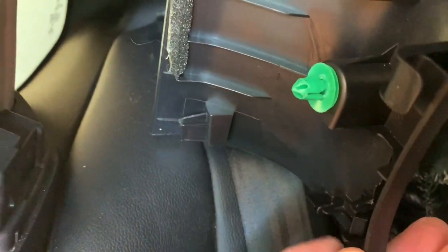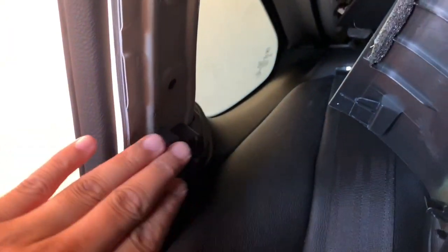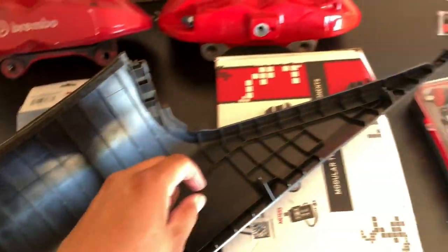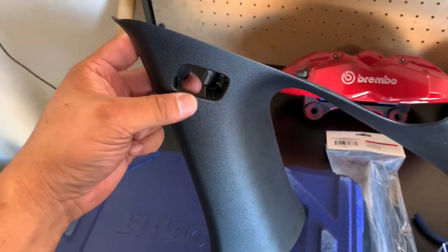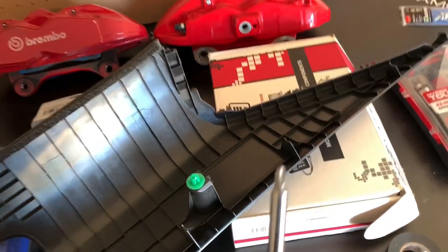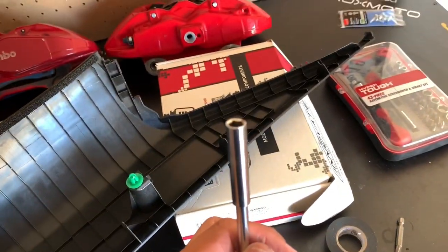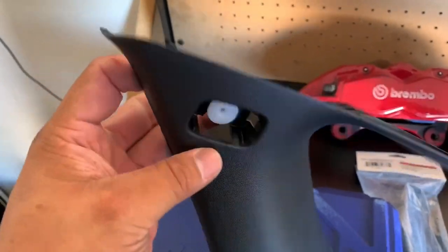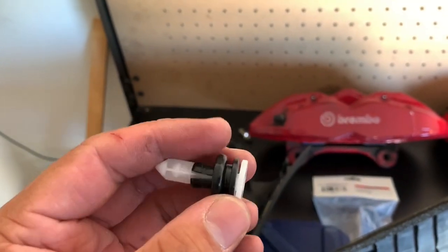It's starting to come off. On the inside, this makes a connection point. In order to get it off you have to depress it backwards, and the same with this piece of plastic here. After giving this panel a thorough inspection, the green ones are normal clips. It's actually this piece behind that little airbag symbol. You pop that off, and you can use something like a screwdriver point — something blunt that you can stick into this. Once you hammer it flat, it engages the barbs and is able to pull itself free. You do need to reset this to get it back in.